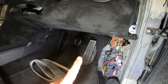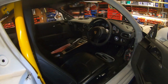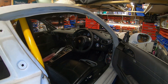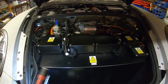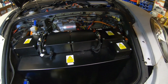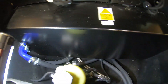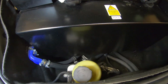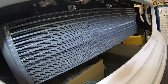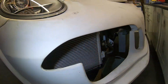I managed to get the Boxster accelerator pedal to work with a T2C controller, which makes the motor spin faster. In the front of the car, the battery box is all plumbed in — all the coolant pipes are in place. My power steering pump is connected and plumbed in. There's a radiator on the front of the car for the battery circuit.